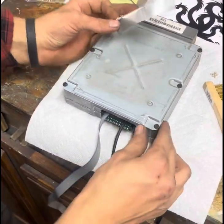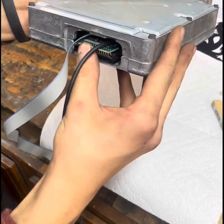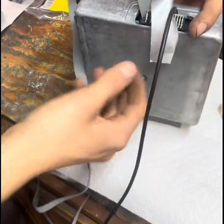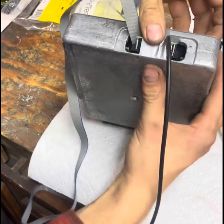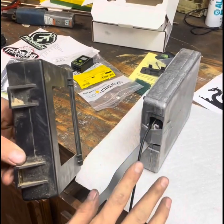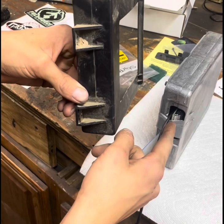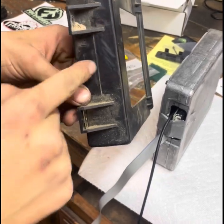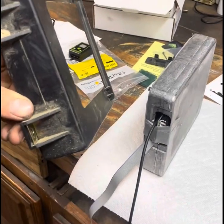Really important step: once you have your chip installed and all your bolts snugged down, you can see your chip hangs out a little. It's not the tightest but it's not loose, so it will work. Take a piece of duct tape and go right in between your two wires here — this will ensure that your chip won't come loose when you're hitting big Michigan potholes or anything crazy like that. Once you have all your duct tape on, take your plastic cover and make sure the ground clips in there. I marked the area where the hydrochip sticks out in red marker, and I'm going to take my air saw and trim that out so it's good to go.